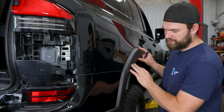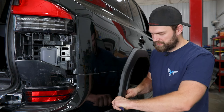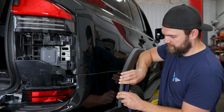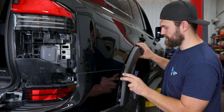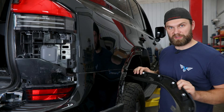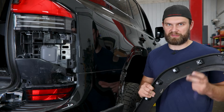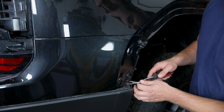Now this is when you'll need to pull those flares out if you haven't already. A plastic pry tool is helpful here. You've got two clips in behind here — these are the trickiest and the stiffest to get popped free — and then all of the ones along here come out pretty easy. Hopefully you removed all of those clips along the bottom because that'll allow these to all release, and we can just get this thing safely out of the way.